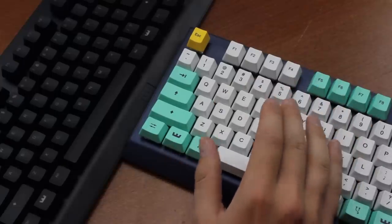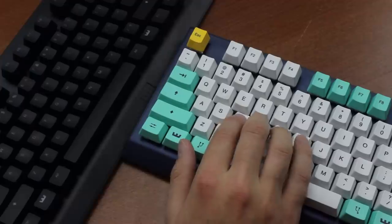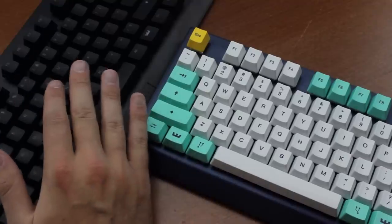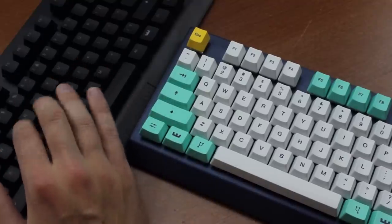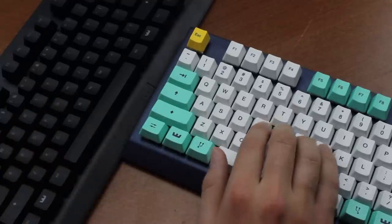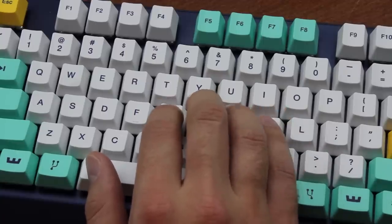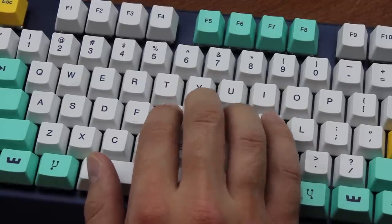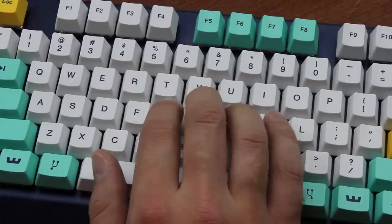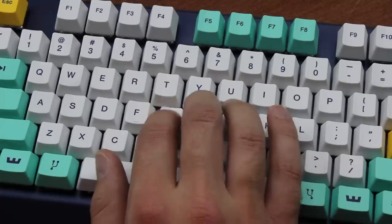The first and foremost thing about contactless switches like these, in my opinion, is the smoothness they can grant. When the original Wooting came out, it wiped the floor smoothness-wise with anything else on the market at the time — forget your Gateron Inks and lubed whatnots, they cannot stand up to switches like this. So does the Lekker still hold up? Well... yes. In scientific terms, it's fucking smooth. The weighting is nice to boot — it's very similar to MX Red, 30-60 grams linear. However, compared to MX Red, it's much smoother, and this actually makes it feel lighter as well.